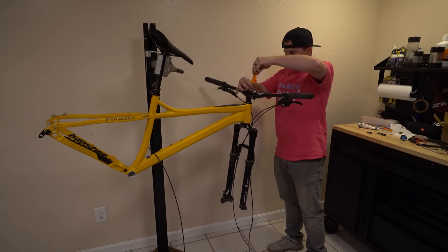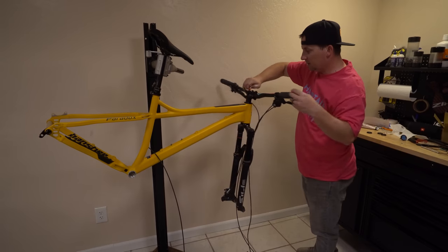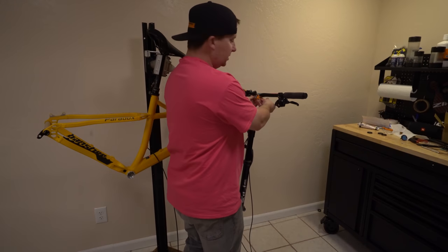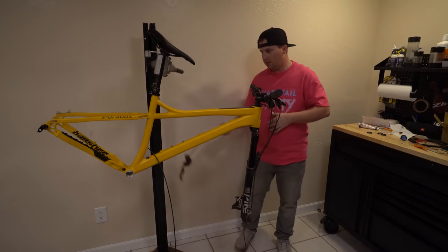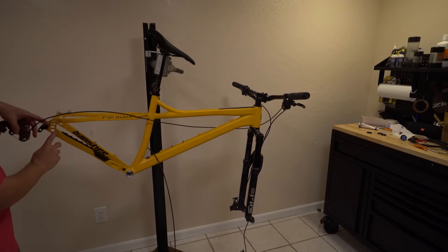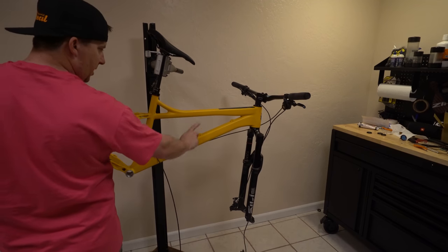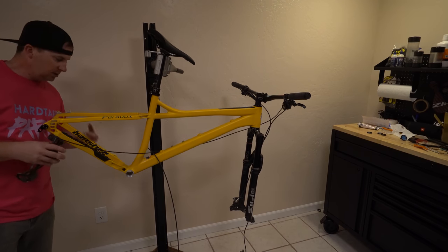Sweet. I'm digging this color big time — it's very different. I like colorful bikes. Here's a little tip: tighten your headset a little. If you can feel resistance, it's too tight. If you can tighten it a little more, feel a little bit of drag, back it off a little. This is kind of nice actually, not having to change my bar angle or where my grips are. The rear derailleur comes through here — oh interesting, it's internally routed through the chainstay. So I need to pull that off. This is the all-three kind — it does your dropper, your rear brake, and your derailleur. And I'm glad that they have external brake routing. I hate internal brake cable routing. I think that's the dumbest thing ever.